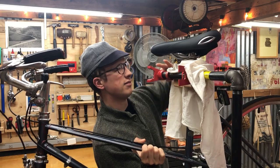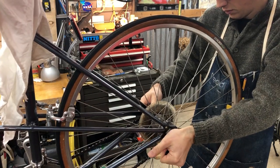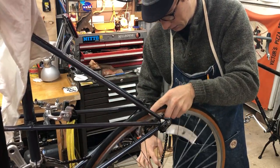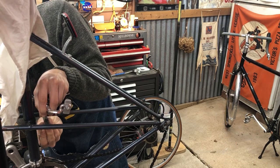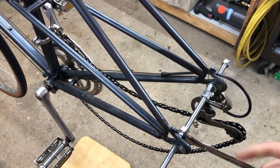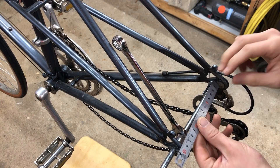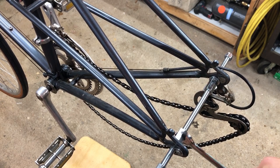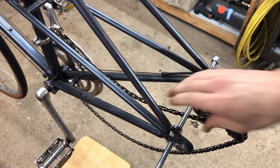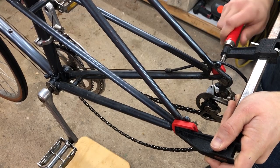The first thing I did was remove the rear wheel and the brake and attempt to adjust the rear spacing from 126 millimeters to 130. The plan was to use a set of wheels I had on hand that I had pulled off of my Rivendell Sam Hillborn when I first bought it. I used a homemade spacer — a piece of all-thread with a few washers and sleeves on it. I had over-spanned the back, so I used a clamp to pinch it back into shape.